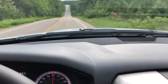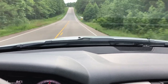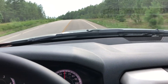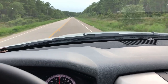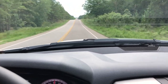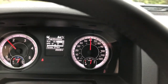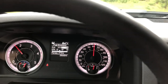We have a fitment issue with the tires — a lot of guys run negative 44 offset, but we're running negative 18 on 35s, which is barely touching the inner fender and fender flare. Our speedometer is also off — when going 55-56 it's showing about 61. We're going to use Alpha OBD to reset the speedometer and ABS calibration, and then I'll show you the alignment specs.